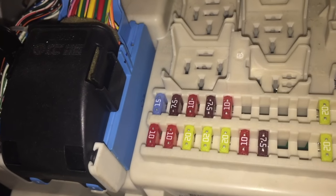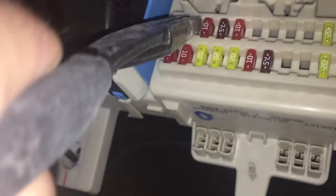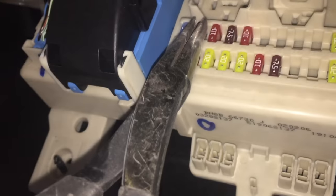If you take a look at the plastic cover you just took off, there's also the layout of the fuses. Turn it around and on the top row, second one to the left, you see 'seven and a half amp, radio' — so this is the right one. You want to pull this one out using either the fuse pulling tool or just some pliers.